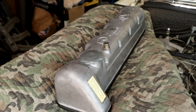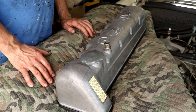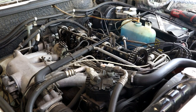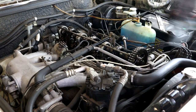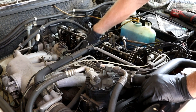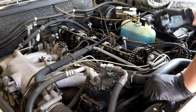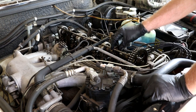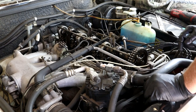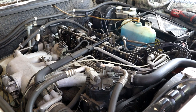You can see the cover came out quite nice - it's obviously got still scratches and what have you but it's got that nice patina, that kind of old look. I wouldn't want it all too new looking - I like those battle scars. It's just clean and presentable. All the valves are adjusted, I've cleaned the surface of the cylinder head, made sure there's no debris down there. I could undo this oiler tube and clean it out to make sure it's unrestricted. Unlike the 4.5, it's metal - the 4.5 has little plastic clips holding the oiler tubes on both banks. That's something you need to change if they haven't been done for a long time.